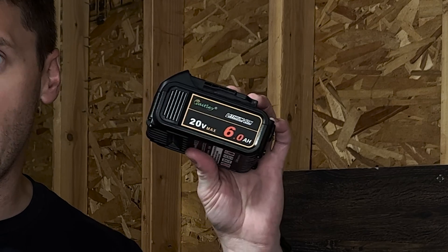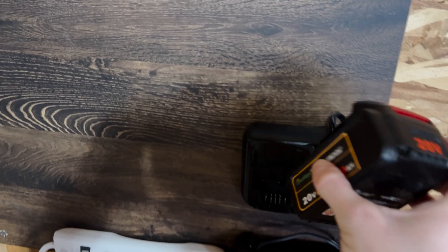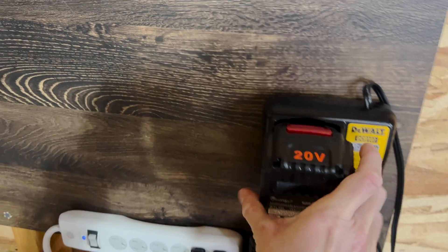To fix both these problems, I decided to swap out the 12-volt stock battery with a 20-volt drill battery, since I had several of these lying around the house. The benefits of this upgrade are amazing flexibility swapping out batteries when they run low, never having to wait for a charge on the stock battery, and supplying 20 volts of power straight to the motors, which should increase the speed of the car significantly.